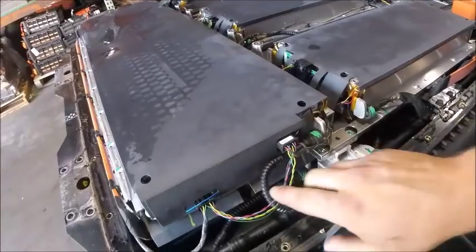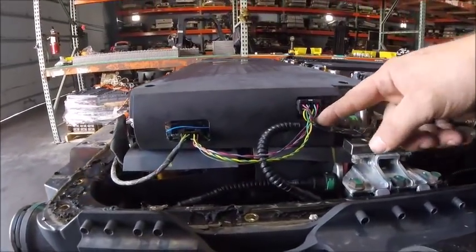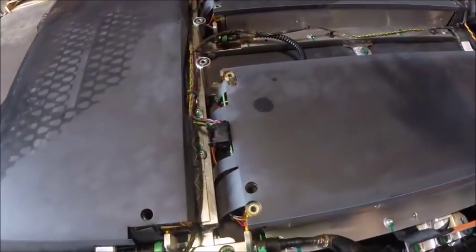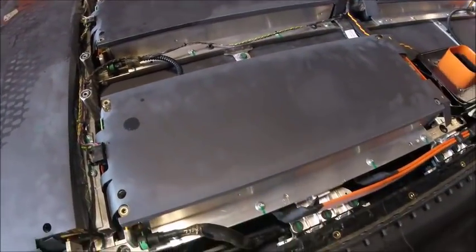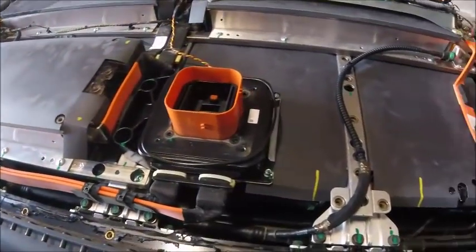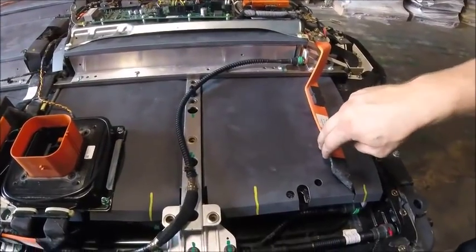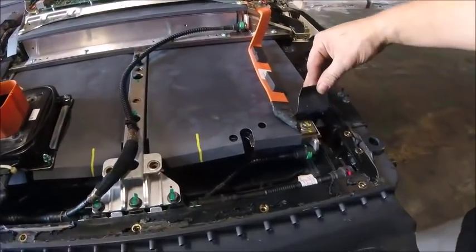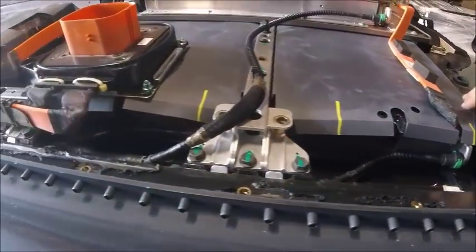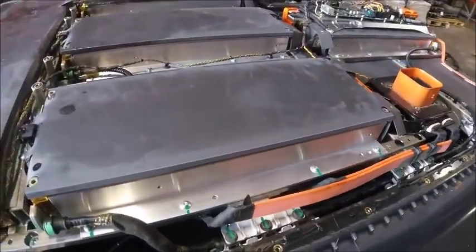So you have the BMS boards under here, and they're daisy chained. And that was the connection that we were seeing go up. And there's one on the smaller ones, and there's 2 on the bigger ones. And essentially, one big one is 2 smaller ones put together. So we have the bus bar going along the entire battery pack in various places, and there's water damage, it looks like everywhere. So we'll see how this one turns out, if there's any use from it or not.